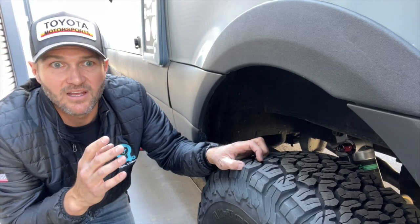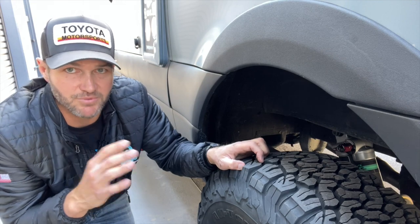The most important thing to do to a van that's built out, if the rear leaf springs are collapsed, is to replace or add spring rate to those springs to get the van at the correct ride height and get the spring functioning properly. Once you've done that, adding shocks is a no-brainer — the expense versus what you get is absolutely worth it.